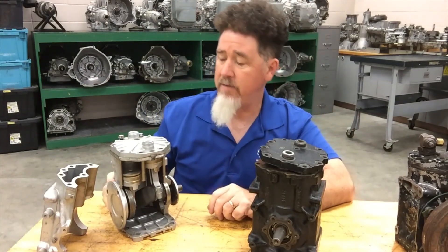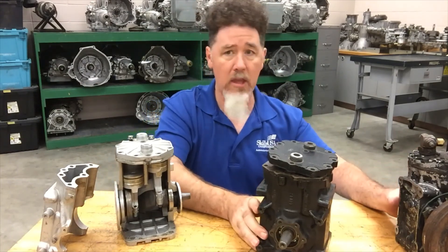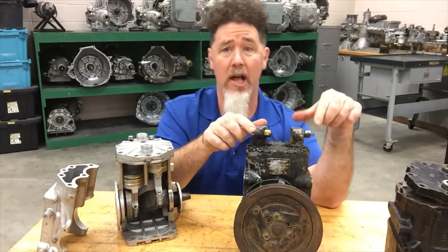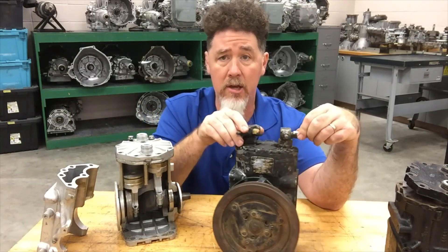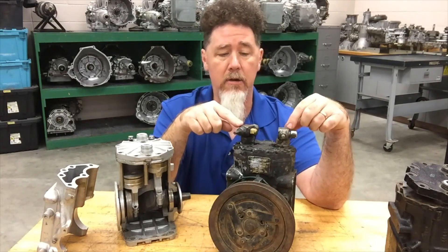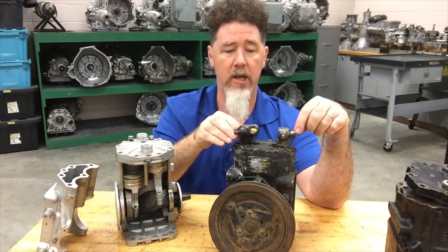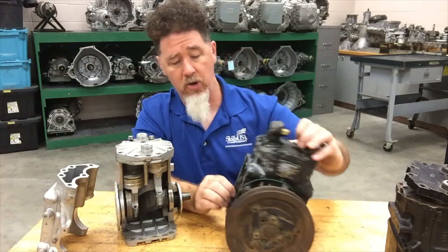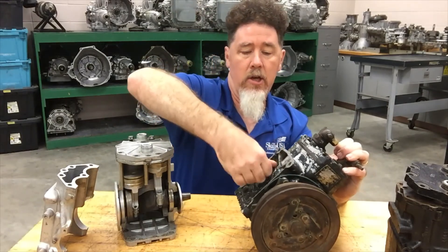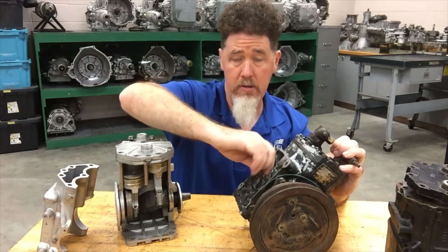They used this all the way up into the 80s — I actually have one of these on my 85 Grand Wagoneer, so it's kind of fun. This one here has the clutch on it. A lot of times with these inline compressors, there's a set of service valves on them, and a lot of times there'll be a cap on it where you don't even see the stem. It also has a spot where you can check oil — you have a sump on these that will hold oil, so you typically find some type of dipstick.